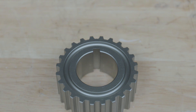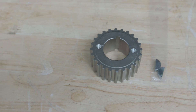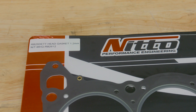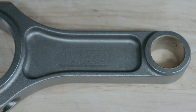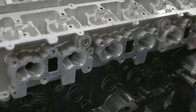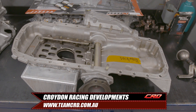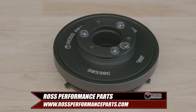Externally, we're using the new Nitto crank pulley, which is made from stronger material than factory and has two threaded holes in it for easier removal. The reputation and track record of Nitto Performance Engineering products, combined with the fact that they're designed in Australia with local support, made it the perfect choice. ACL race series bearings and ARP main studs along with Tomei head studs finish off the parts list in the bottom end. We reused our CRD spec enlarged sump with baffles and extended pickup, and we're also reusing our Ross balancer.